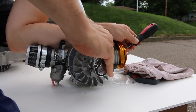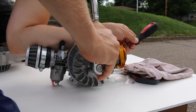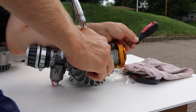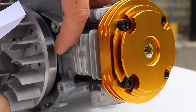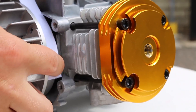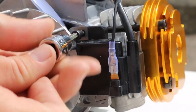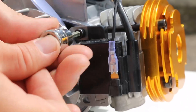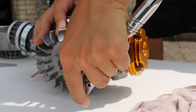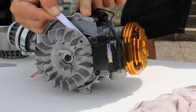We're back to the screwdriver trick in reverse to tighten the flywheel down. There's no need to rubber mallet the flywheel on — the screw will press it on. Just make sure it's tight enough. After that, find the magnetic part on the flywheel and slip a piece of index paper on that magnetic strip. That way you can get the ignition coil on there as close to the flywheel as possible for maximum performance. Once the coil is screwed down, pull that piece of paper out and it'll keep the coil as close to the flywheel as possible.